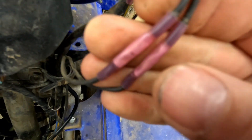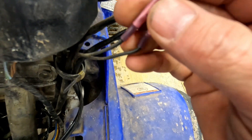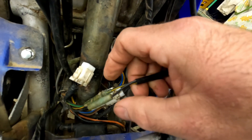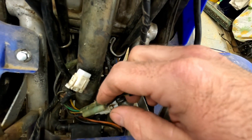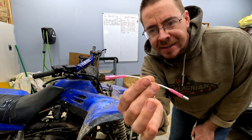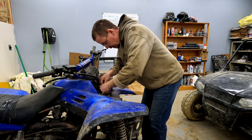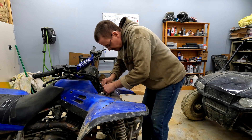You can see here this has been bypassed before — I hooked it back up, so that's probably part of our issue right there. I'm just going to unplug this. These bullet connectors make up a quick little bypass so I don't have to actually splice them. I'll just pop in a little bypass wire. Here's my simple little jumper wire — I just took a little piece of scrap 18-gauge and put a couple bullet ends on it. Now I should just be able to plug her in, and that will bypass our clutch switch.